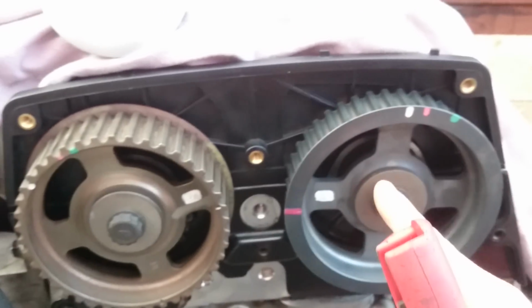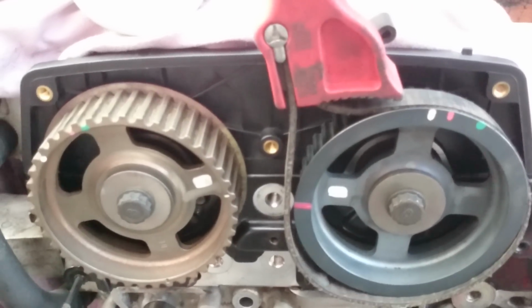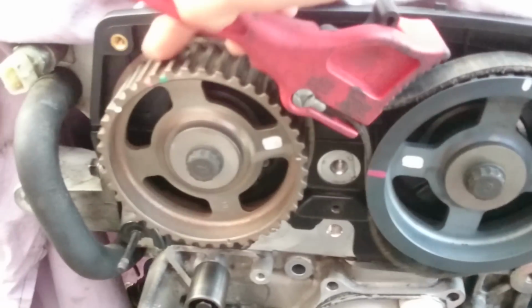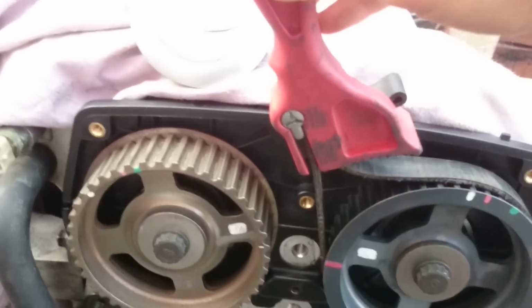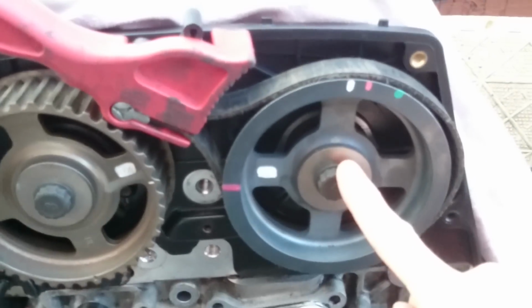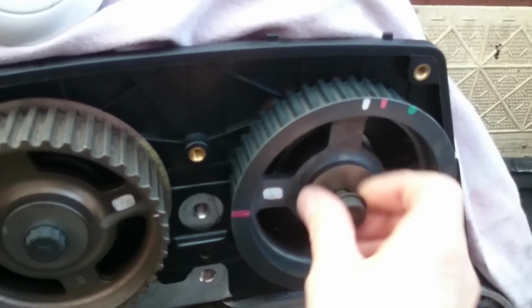Okay, so in my case, we need to unscrew the bolt on the opposite side to the clock, so we need to hold this with the rubber strap. That's the wrench which I like to use. Tighten them. Don't use a chain or a metal one, because you damage the wheels, which work together with the belt later, so that would be dangerous to use. We use this rubber strap wrench with a 13 and then a 19, which is here. Yes, no, sorry, 17. Number 17 here, and then we need to loosen these two bolts. With the strap, it's a simple job. When we loosen them, the wheel washer, the solid washer, we need them back.